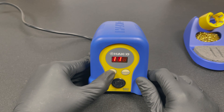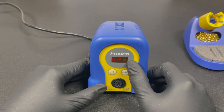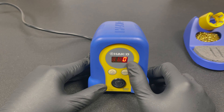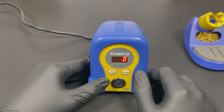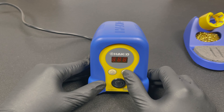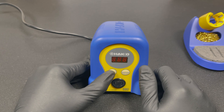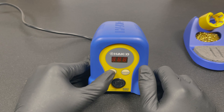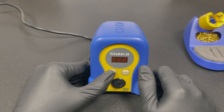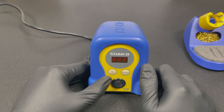Back in the menu, press up to go to setting 11, which is the temperature setting mode. It displays 0 for manual temperature select, where you change the degrees by hand every time. Press up to select preset mode — you get the choice between 2, 3, 4, or 5 presets between which you can toggle and change temperature. We'll set it to 3, then press enter to confirm.